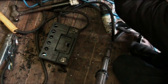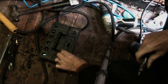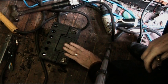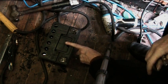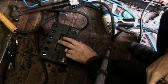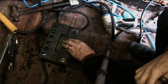And it goes up to 130 amps tops. Now we're not going to go anywhere near that, because I don't think this battery requires it. I don't think the plates have much corrosion, being a newer battery. I think it was mainly because it was low on juice. But we're going to give it a blast anyway, and I think 25 amps should be enough to clean those plates off, because they shouldn't be very calcified at all. As I say, this battery is less than a year old, so it shouldn't be anywhere near as bad as the original battery.